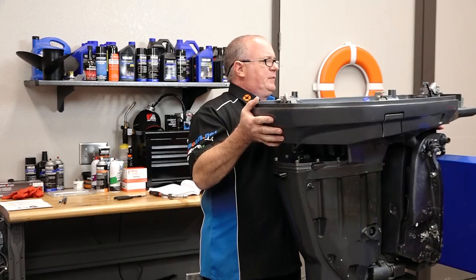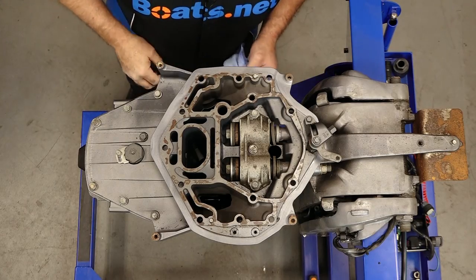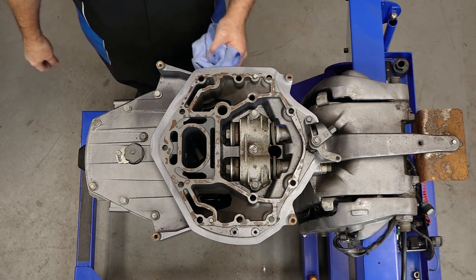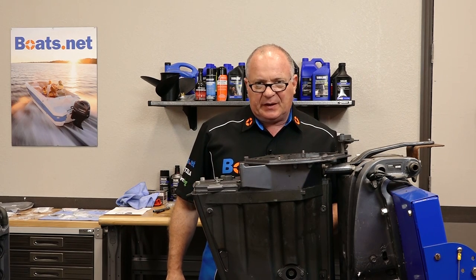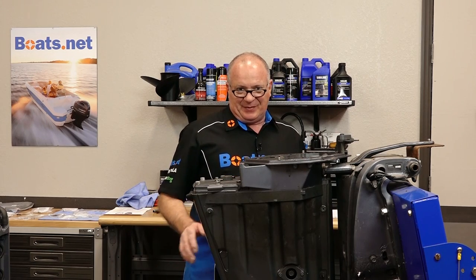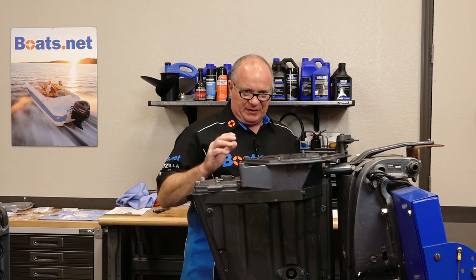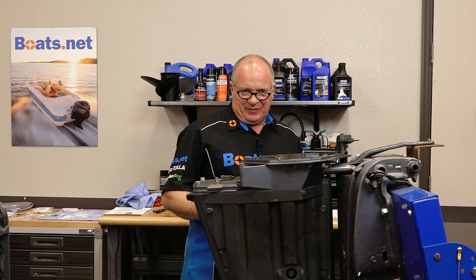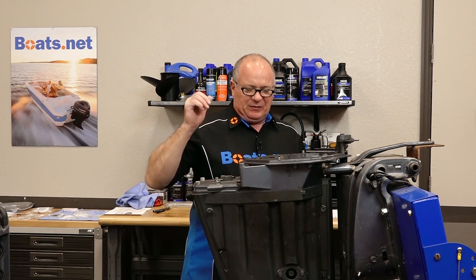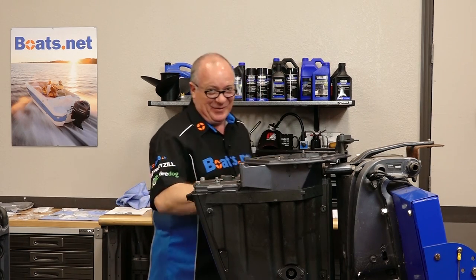Go ahead and get her lifted off. Well, someone has definitely done the corrosion kit on this particular midsection, but like I said in the opening, I'm not going to trust that. We're going to go through and replace it. Now if you want to see just how bad the corrosion was on this one, look at the bottom end teardown. It actually ate all the way through the crankcase itself, going from the water jacket straight into where one of the oil passageways was. And when you filled that up with oil, oil ran out through the exhaust. It was bad. Real bad.